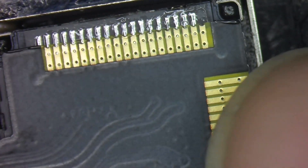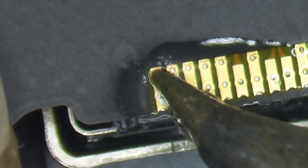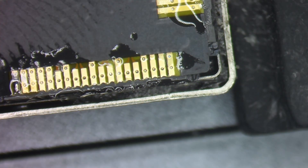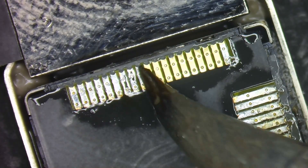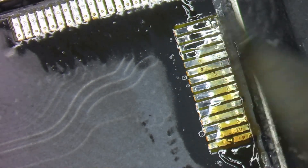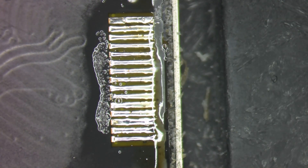Here I've got my flex cable. We'll line up the flex with the corresponding pads and add some flux. Now I'm going to carefully go in and tack the edge here, then diagonal of it go up to the top, line up, and solder the other one just to make sure everything's lined up properly. The solder will pull through those two holes in the flexes. Now I'm going to go over and pull up the solder through all of the holes, getting that flex nice and flush against the back of the camera. I like to add a little bit of additional solder just to ensure I've definitely soldered each one of these points down. I want to make sure all of those holes are filled.